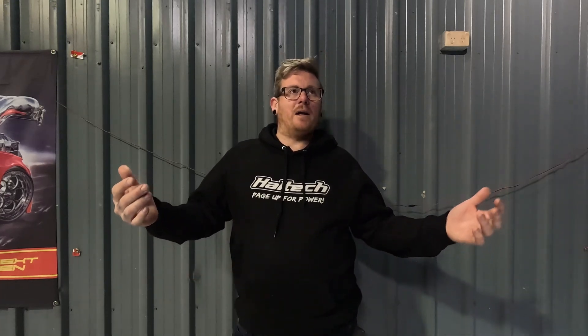So that's the VF SV6 project finished up — really cool kit from Kappa. We didn't have much dealings in getting the kit; the customer supplied the whole kit to us. Got an entry level kit with an intercooler optioned into it. Cool thing is with the LFX being a DI engine, you don't need to do fuel system stuff — injectors in it are good enough, high pressure pump's good enough. 400 rear wheel horsepower, super impressive — well, 390 was its best.